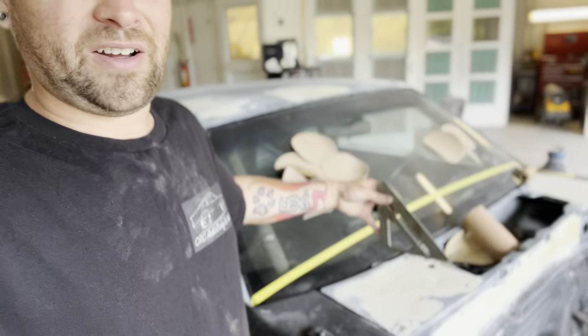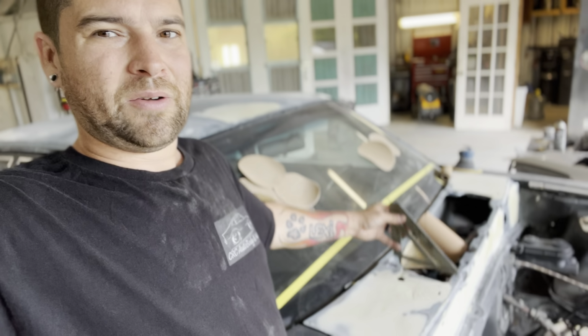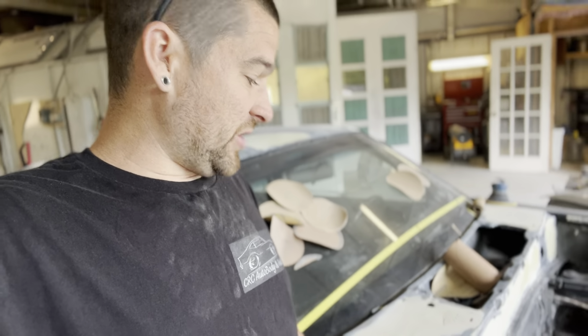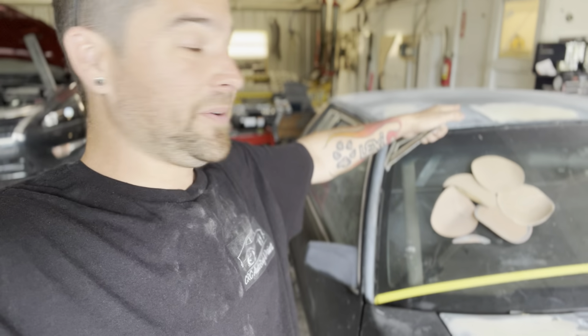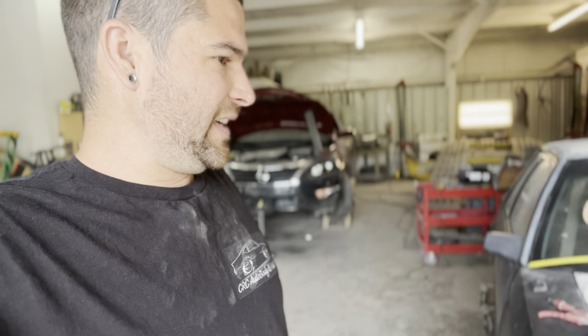We're gonna check this cowl panel out just to make sure all of our edges are flat, right here, down there on the other end, and the ones going this way. Just make sure everything around the edges is flat, and then re-skim coat this one. We got to sand out that one up there, re-skim coat a couple of dents and dings, and then I guess I might move on to fitting the hood, even though I really don't want to.